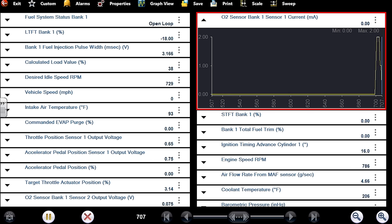I'm calling the MAF on this one, Danner. The fact that my unplugged calculated load number is half, and this MAF is all over the place — there's something going on with this MAF. I like a ten dollar used mass airflow. That gives us a cheap test rather than spending $150 on something that's going to be impossible to prove. It's always tough to call a skewed mass airflow sensor.